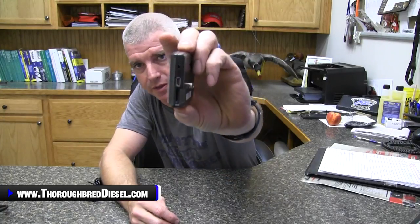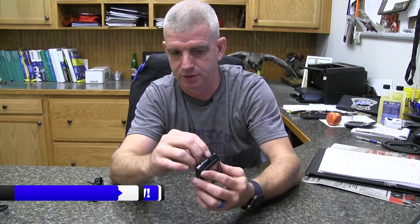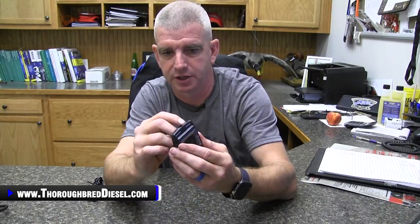All right, we have got our update done now. So what we're going to do is take the SD card out of the USB slot, and then take it out of the dongle. Then we're going to put the SD card into that notch right there on the bottom of our head unit. It will only go one way, so do not force it. Once you have it going the right way, you can feel that it's going to want to engage the slot correctly. Just take your fingernail and push it until it clicks. And then once it clicks, you've got your SD card in.